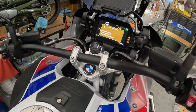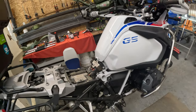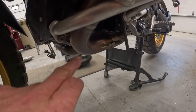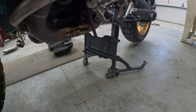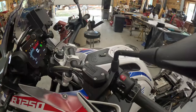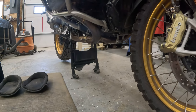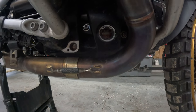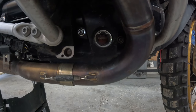Service overdue light is on — I'll show you how to change that later. I can see a little smoke coming off the header because oil does spill on it during the filter change — that's normal. I'm not seeing any leaks on the ground. Let the filter soak up oil for about 60 seconds and you can see the sight glass filling up. It should be just underneath that top line, and if you give it five minutes after you change the oil it'll be just under that top line.